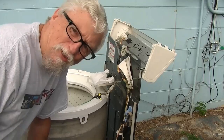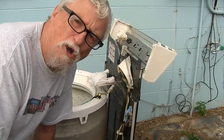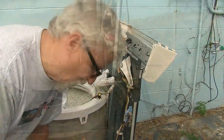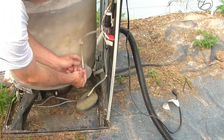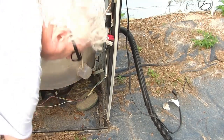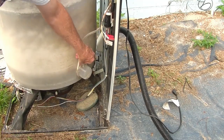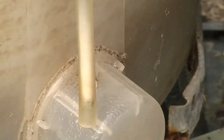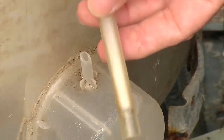There's one more thing — if you can't get the air to go through there, there's one more thing to check. Because all these things will make your washing machine overflow; it won't shut off and it'll just keep putting water on the floor. This little tube right here — you see how the soap is on this hose? Sometimes you'll get soap and scum build up inside this little tube, and you'll need to take something and push that through. Make sure that it is cleaned out.